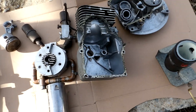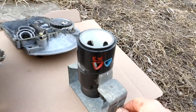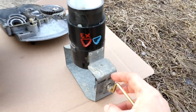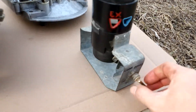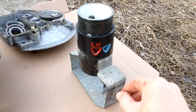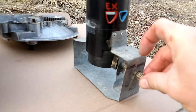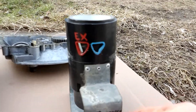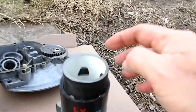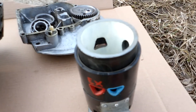I'll just point out the parts here. The first thing I'm going to review is my little sleeve valve model — shows you the sleeve at the top there, so that little crank shows here and it's got the ball joint mechanism the whole thing. The sleeve is at the top, it fires, comes down, starts to open the exhaust port, then the intake port comes next. You can see on the far side there's a compound port in the sleeve.